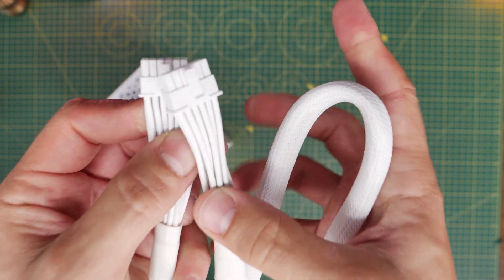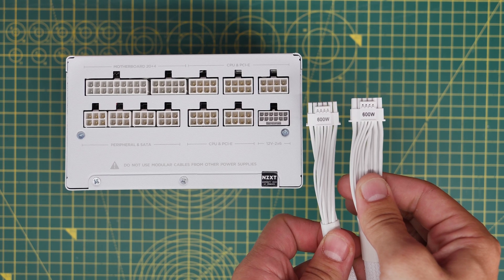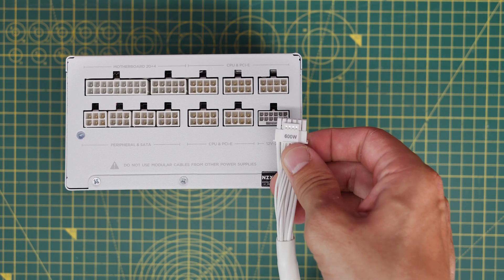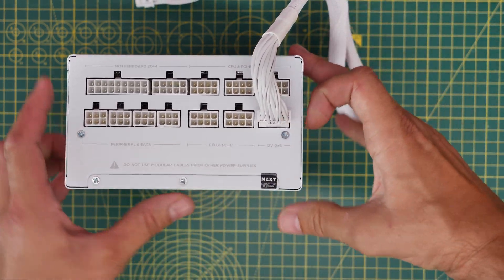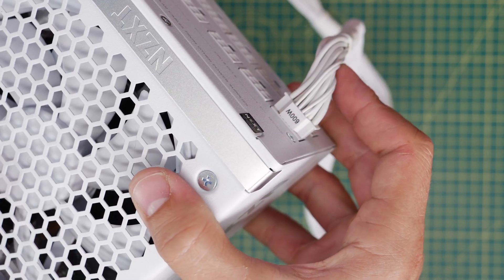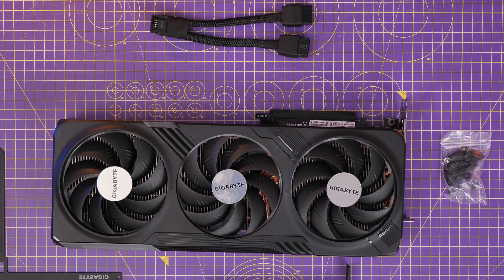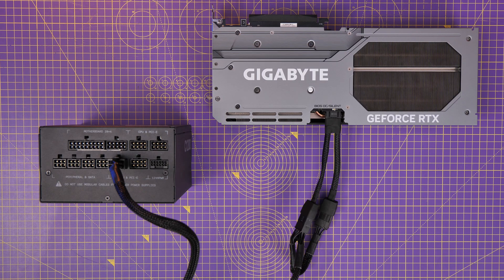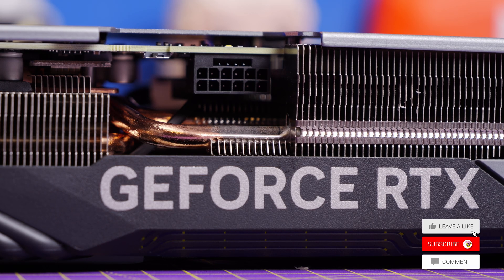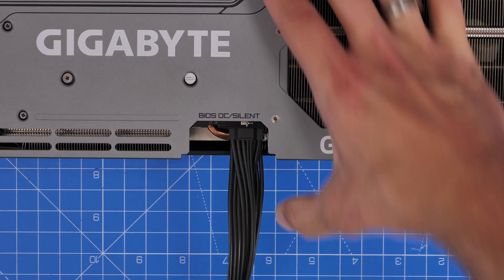Alternatively, you have the 600-watt 12-volt high-power connector, which has the same connection on both ends and plugs into the 12V 2x6 port in the bottom right. This is intended for Nvidia's 40-series and beyond graphics cards, and basically replaces the standard adapter you'd usually get with those GPUs. For example, the Gigabyte 4070 comes with an adapter requiring two 8-pin PCIe connectors, which makes a mess in your case — so you can just swap that for the 12-volt power connector instead. You do need to make sure it's seated carefully into the graphics card and power supply, pushed all the way in so the little notches go in fully.